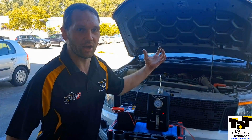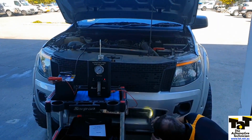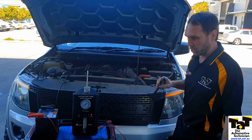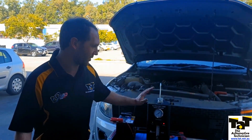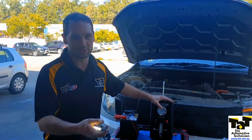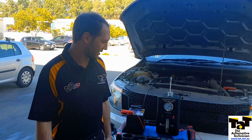This one is still filling up. Drum roll - we all know it's a Ranger, it's either going to have a hose or an intercooler. I can see it coming from this area. Sure enough, the hose is alright, but this one definitely has a split intercooler. The rupture is so large that it only required just over a PSI to find that leak. This is going to come in super handy for things that have burnt me - like a Mercedes Sprinter where the intake manifold bolts will snap, and you get a boost leak but only under boost. You will not find that with a regular smoke machine.